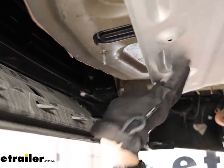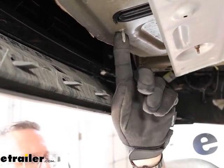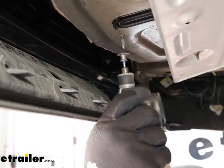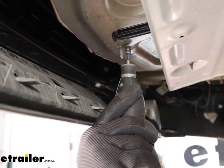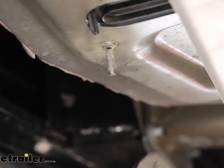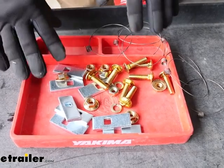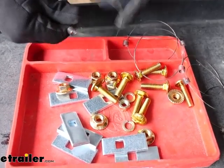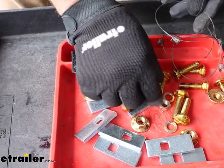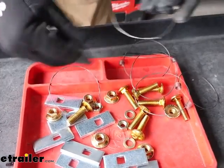With the exhaust down, you can see the heat shield in the center of it. There's a stud here that we need to cut off, so I'm going to use a Dremel tool — you can use a Sawzall or whatever works. Just remove this stud by cutting it off as close as you can to the trunk. You don't have to cut all the way through; cut mostly through and use pliers to break it off. This is the hardware you'll get with your hitch: fish wires, spacer blocks, flange nuts, and then a couple of regular nuts and lock washers. This is what we're going to use to bolt your hitch up to the Lincoln.